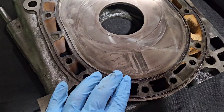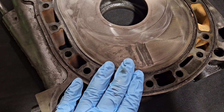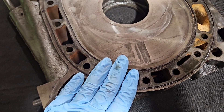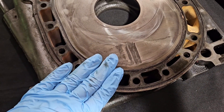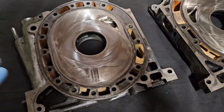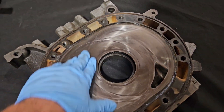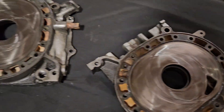In this particular case, they came in because of this water corrosion right here. This type of water corrosion is due to water or moisture sitting when the car is not running, most likely after the car has been parked for some unknown reason. This type of corrosion can cause accelerated wear both to the side plate, the side housing itself, and the new components going in. So to protect your investment, it's best not just to throw these components back together again for another rebuild — they have a couple thousandths of wear at this point.